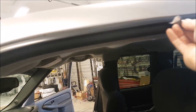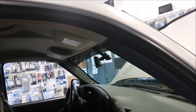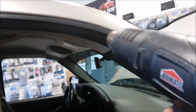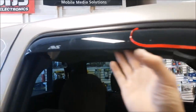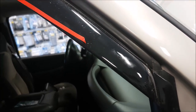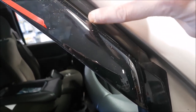Flip it over and do the other side. It is a colder day today, and because we're dealing with adhesives, I'm going to use the low setting on my heat gun to help warm this up — you can use a hair dryer as well. To install it, leave most of the tape on so you can wedge it in and slowly work it into place. The instructions don't say to pull off the mirrors, however there is this support piece here.